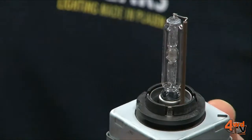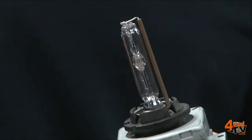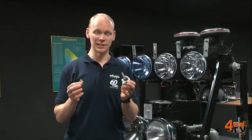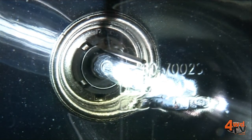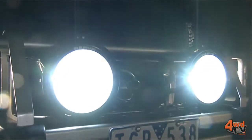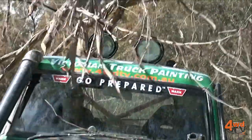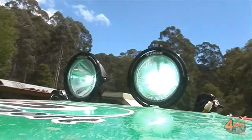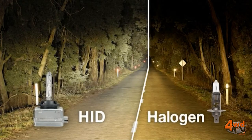Now let's have a look at our HID globe. The principle is the same in that it has a gas inside the glass tube, but the way it ignites is different from halogen. There are two electrodes, and when the globe is ignited an arc forms between those electrodes — a little bit like a welding arc. That arc reacts with the xenon gas and produces an extremely brilliant white light, much greater than a halogen globe. There's no filament to break either, making them impervious to vibration and ideal for the most demanding four-wheel drive applications. This globe is a 35 watt globe, and compared to a 100 watt halogen globe it uses a lot less power, yet still produces three times the amount of light and has up to five times the life — that's almost three thousand hours.